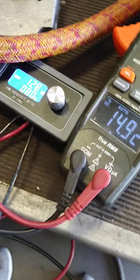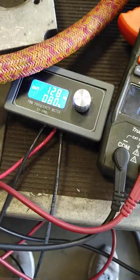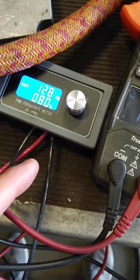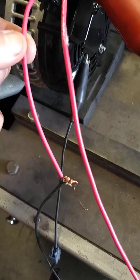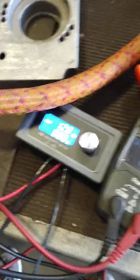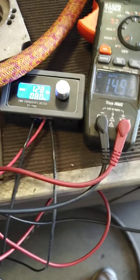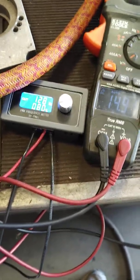On ours, you're going to get the controller with three wires connected: one is ground, one is a 12-volt ignition source, and the other one is going to be connected to your harness that we're going to supply you. We'll actually supply you with a plug harness and instructions, and on top of that, we'll offer you an actual video showing how this thing works — something nobody else offers.